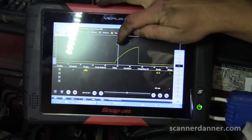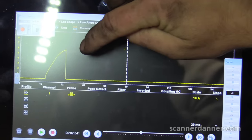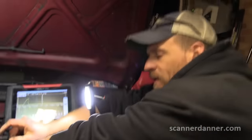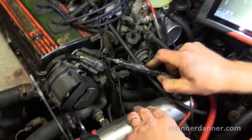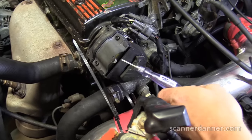You're talking about about six amps of current flow. Six amps says we have to have a good power and a good ground to the coil to have that kind of current. If you didn't have a scope, it's as simple as measuring that same black-orange wire and making sure it lights your test light. I'm not worried about that — just backtracking if all you had was a test light.